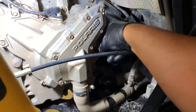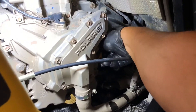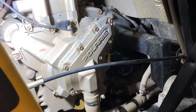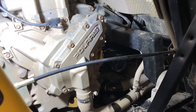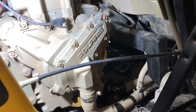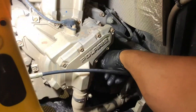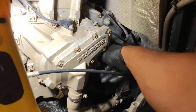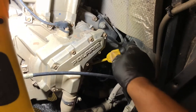The nice thing about this kit is it gives you exactly the amount of oil that you need. This machine calls for two quarts, so that's exactly what I have. We'll set it down so it's level again and then check it just to make sure. Tighten it all the way down, clean it off, check the level — and that is perfect.